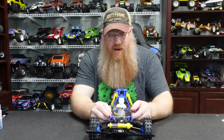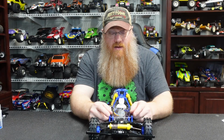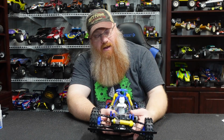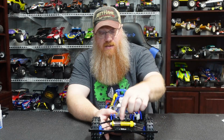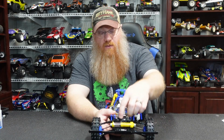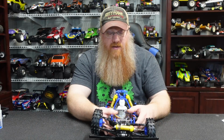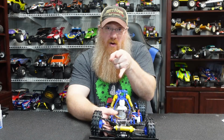The sway bar has much more tension on it, because basically what you want is you want this wheel to pick up. When this wheel goes over in a corner and your car's doing this, you want this wheel to try to pick up to kind of flatten out the car. Well, because there's so much spring tension up here to make the suspension work for both tires, you pick up this side and the sway bar actually flexes, but so do the little mounts.